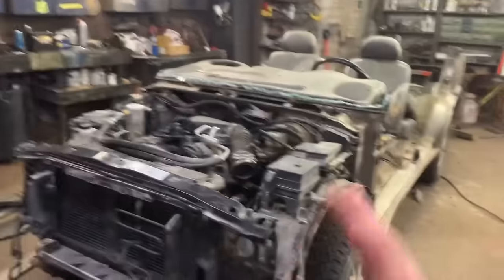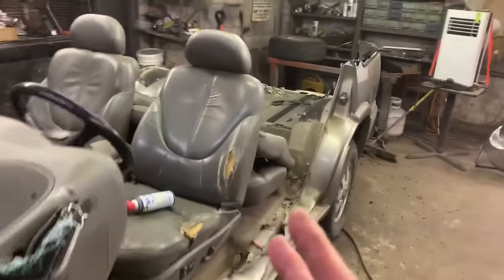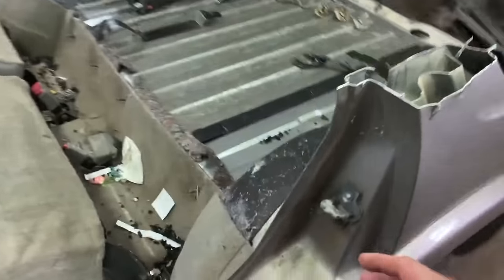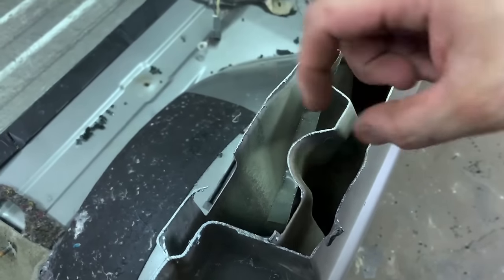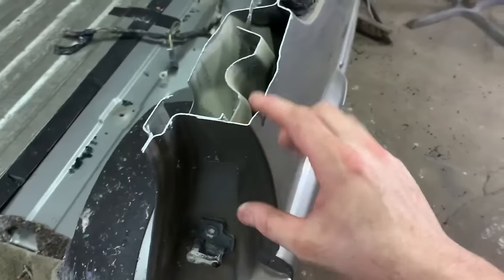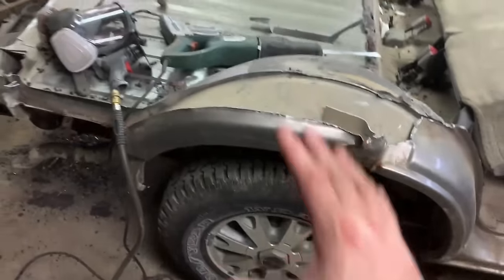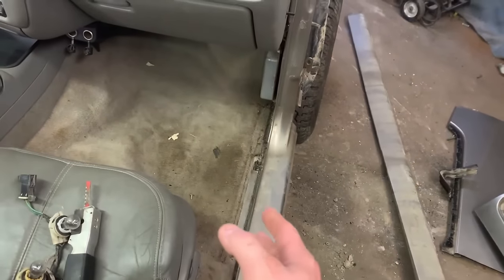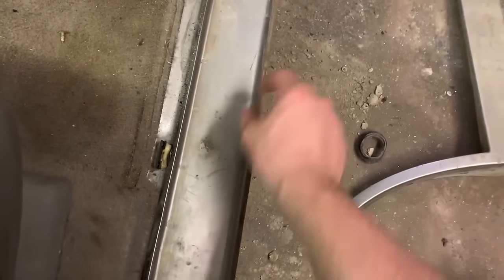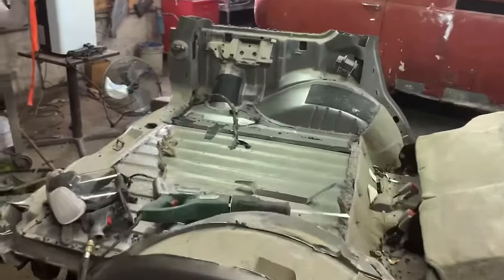So what's funny is I got the roof cut off and the front end cut off - all that looks huge and awesome, but in reality that's pretty easy, it only takes a couple hours. When you start whittling down to get a body on top, it really takes a long time. There are three pieces in here - these two are welded together inside, so you literally have to cut this off in pieces. You can't just run a sawzall through it because it'll bind up. You have to take the whole quarter panel off in one sheet, then the other, then go in with an air chisel. It's a pain in the ass in some bodies.